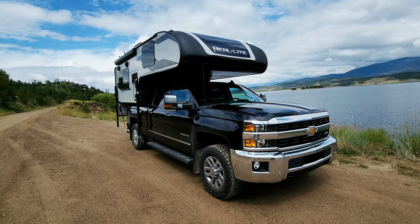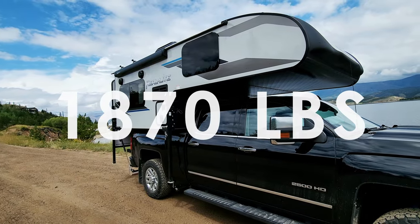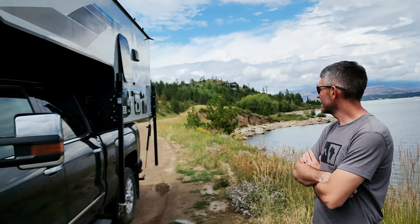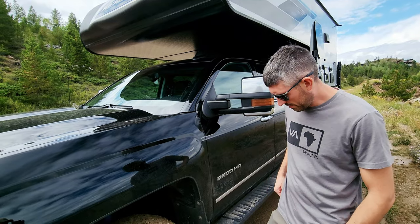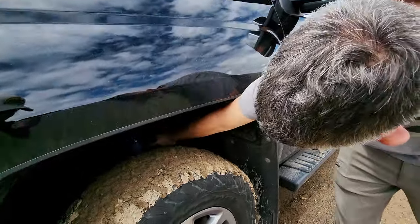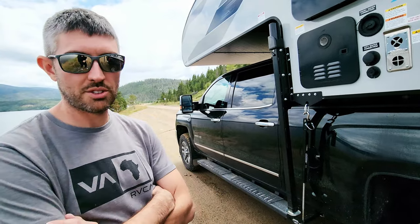This is our setup — a 2015 Chevy Silverado 2500, which is three-quarter ton, and our camper is about 1,800 pounds. My husband Vince is the driver — how's it handling? It hardly feels like it's back there; it feels really good on the truck. The truck came with standard suspension, but we did some upgrades: these are Bilstein 4600 shocks, added all around, which have really made the handling nice.